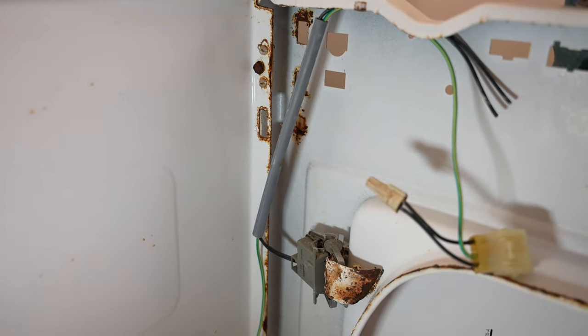The old switch is completely out and in pretty bad shape, so we'll discard it and put in the new one. Put the new switch in the same way we removed the old one. I like to put the two Phillips screws in first — move the switch a little away, start the screws by hand so you can aim for the holes. Getting the second one started is easier once the first is in. Finish with a screwdriver or drill — if using a screw gun, set the torque very low so you don't strip anything. Next, secure the ground screw using the same screw we removed.